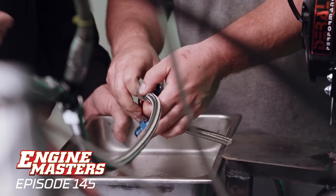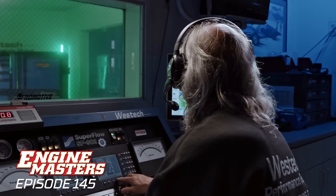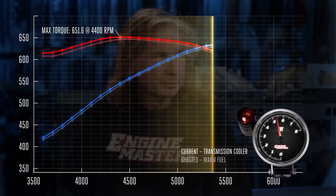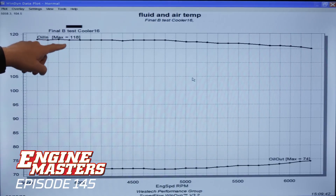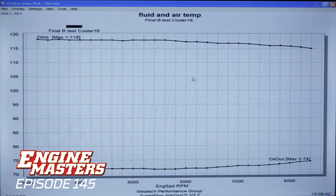We had the fuel running through the heated tank, and now all we're doing is connecting it to the transmission cooler so we'll have a fan to help cool the fuel. Now we have our test with that little radiator in line, flowing fuel with the air blowing through it from the electric fan. The beginning temperature of the fuel from the water tank was really similar to before — 118 degrees. But look at this: 74 degrees at the carburetor after cooling it with that little doohickey. I had no idea we could knock 45 degrees of temperature out of the thing.